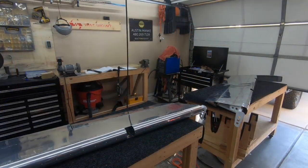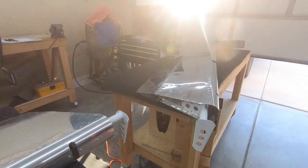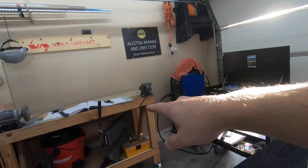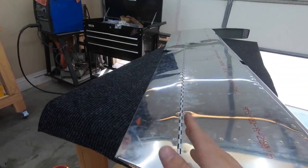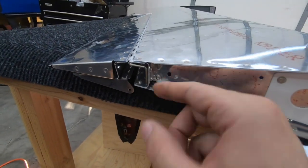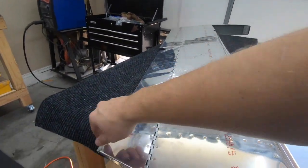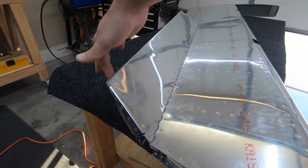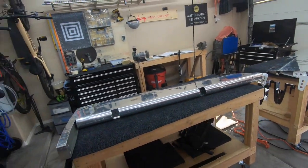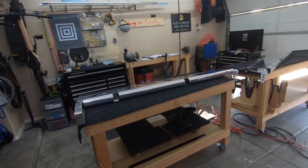Got all that wrapped up. I finished getting these hinge pins put in here. The pin started straight, but we had to put a bend on it to track it into position, and there's a hole right there where some safety wire will go. All ready to go and they function. Really happy with the results. Elevators are complete — next step will be jumping into the actual tail cone itself, which will be a fun part of the project.